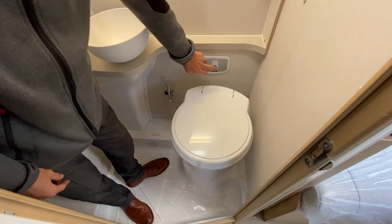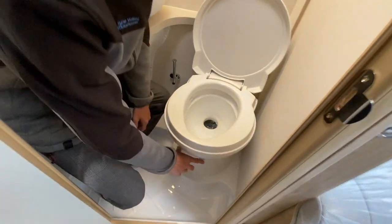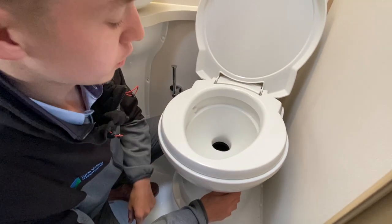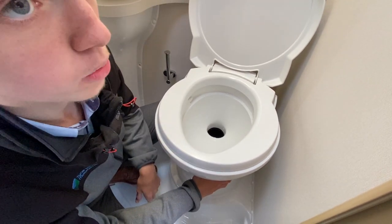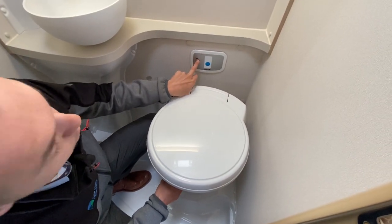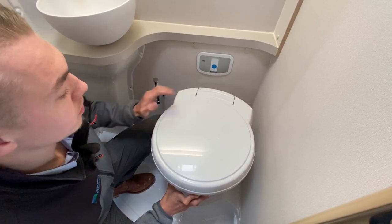To operate your toilet: for the flush press the blue button — make sure the pump's on and you'll get the flush from the main fresh water tank. To deposit waste, use the grey slide on the bottom of the toilet and slide it to the right; it will allow the waste to drop into the cassette. If the trap door is open you cannot remove the cassette — it must be closed, and it must be closed when travelling. The diagram on the toilet shows the cassette level: once the indicator goes red it's nearly full, about three-quarters full, so it should be taken out, cleaned, refreshed and put back in.